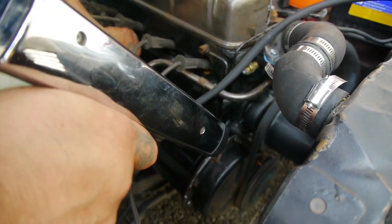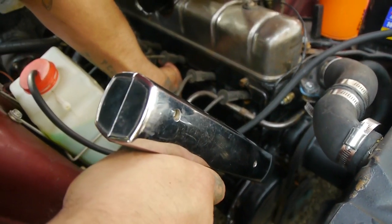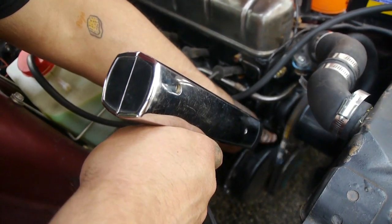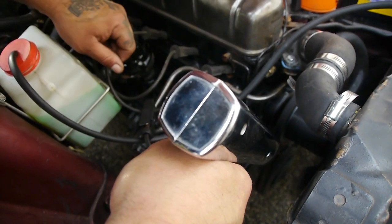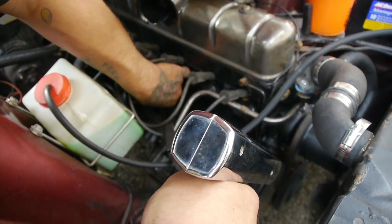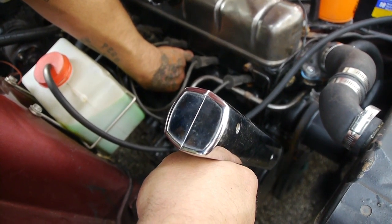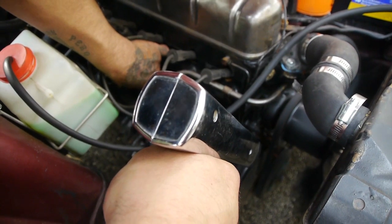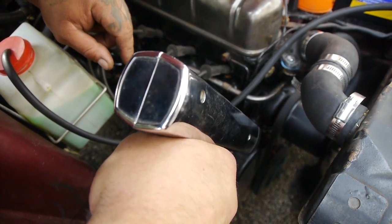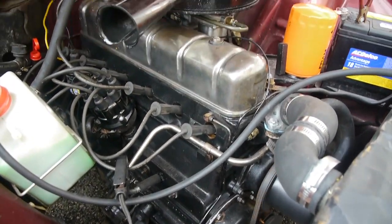And now we're gonna turn our distributor. We got to loosen it a little bit, and we're gonna adjust. See that line move? My point of reference is that little orange screw right back there. It's supposed to be at 5 degrees. Let's see, we gotta get right about there. All right, I'm gonna turn it off, let it cool down, and then try this again.